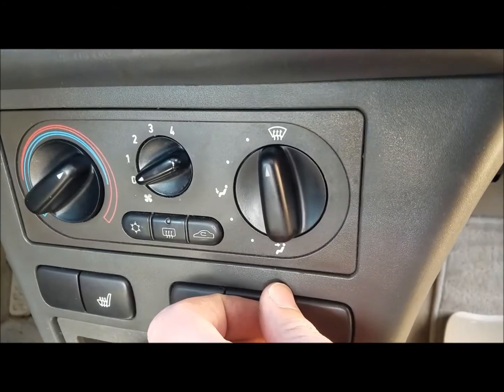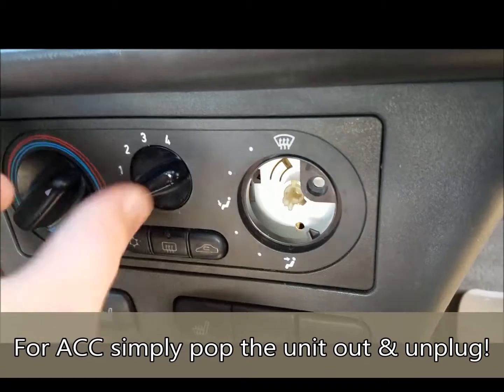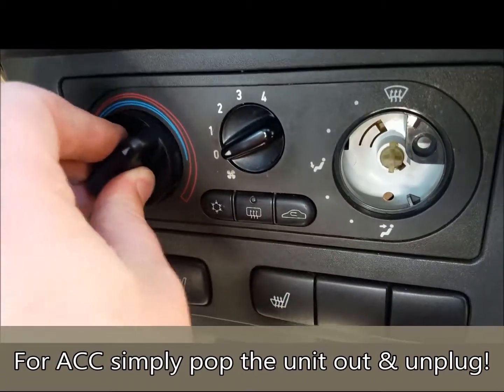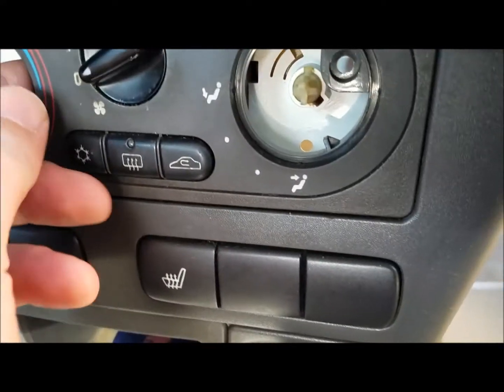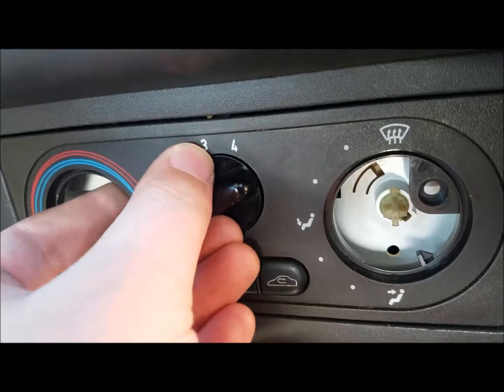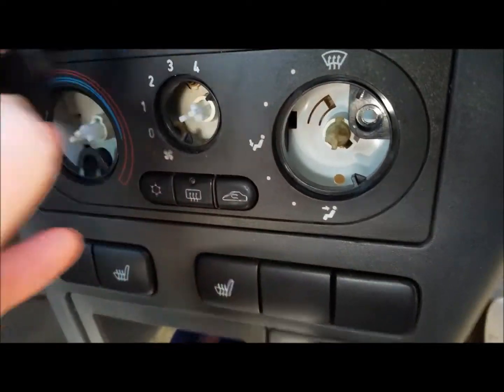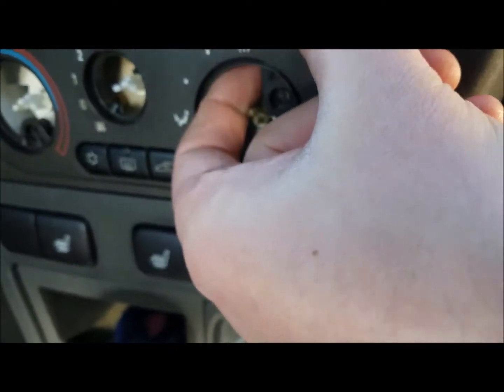To take this thing apart is really simple. First, we're just going to remove each of the knobs for the vent direction and the temperature control. They just pop right off. This little knob tends to come out when you remove this whole face, which you do very carefully. Oopsie, look, there it goes, already popped out. And very carefully just pull up on the entire face panel.